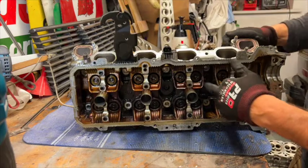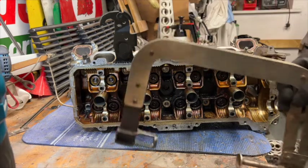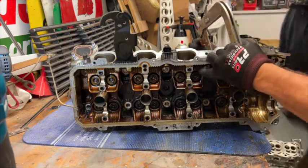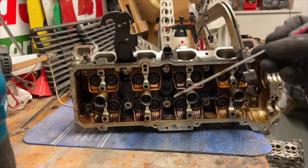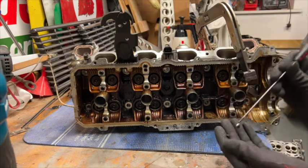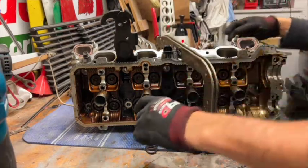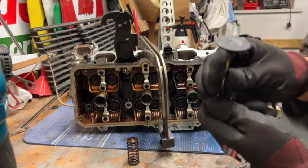So on the back of the head, you've got the valve retainer and the valve. And this is my valve tool, C-clamp style. So I'm just going to take one out - let's go for the inlet on this end. It goes over the valve, quick clamp. And then I've got a little magnetic screwdriver. And one keeper, two keepers - keep them safe. Undo this. Off comes the spring. And then push out the valve. And there we go - one valve.